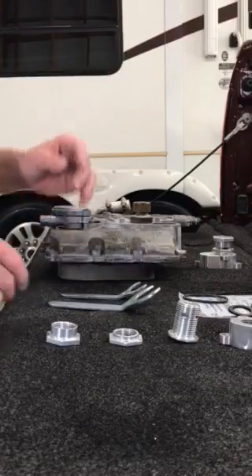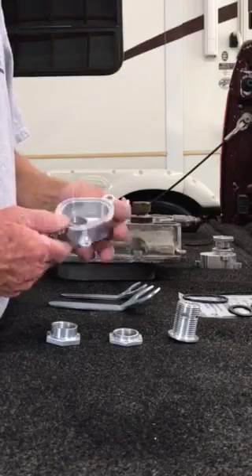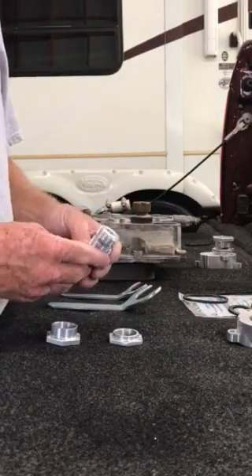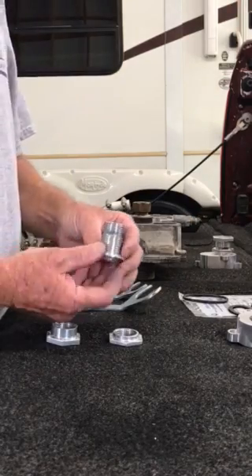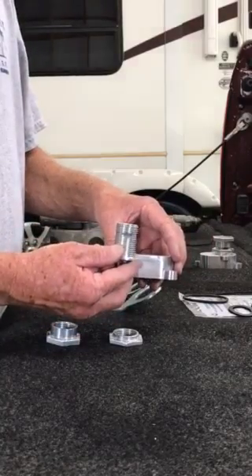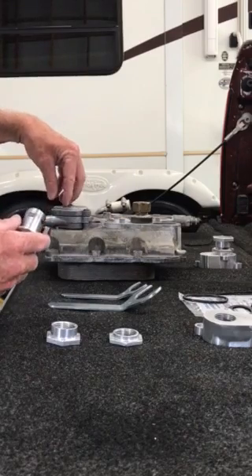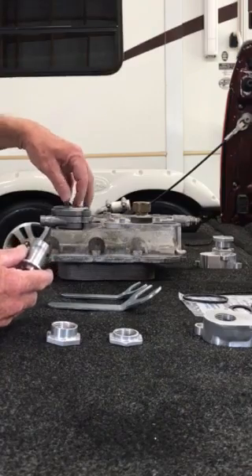All of these parts are aluminum, they're all CNC machined. We have a basic back flush valve housing, threaded. We have a back flush valve — I call it a valve stem with a valve seat. This is the tapered valve seat that has the valve stem threaded through the housing. As it goes from the normal up position and you thread it down, this tapered valve seat actually engages the discharge on the coolant side of the oil cooler, which is under this factory cap.